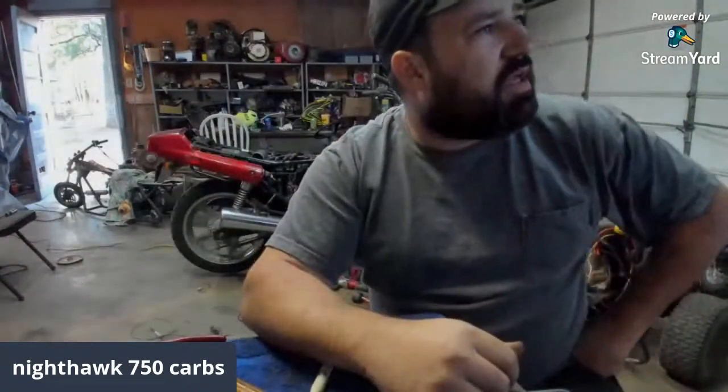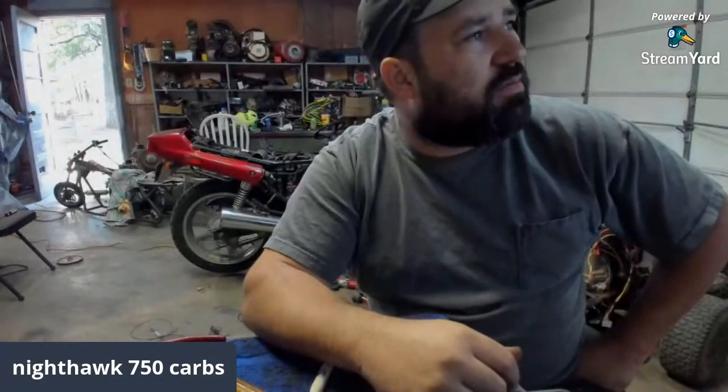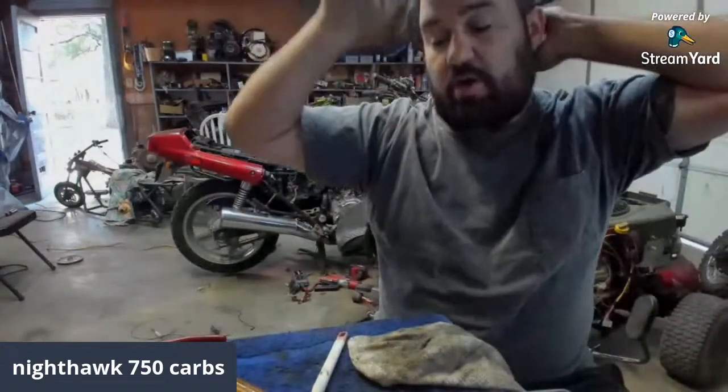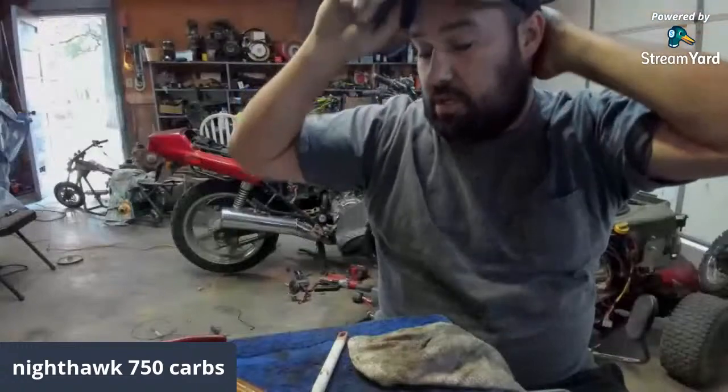My bike has 14,000. Had it since July. Has that been sitting for a while? July, August, September, October. 3 months. It depends on the kind of gas really that you run. If you run 100% gasoline in that bike, I've let them sit 5 months and go outside and start them, and they run just fine. Some people put something like Stabil, a fuel stabilizer, in there, and that helps them for sitting.